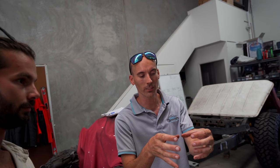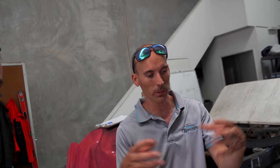You can cut the car in the middle, cut it wherever you want, and you can slide the back half away and slide it back in. Generally, we'll slide the back all the way out, clean it up, get all the paint off it, get it ready for rewelding, and just slide it back in. And wherever you stop, it's back in alignment. Then you can just make your extension, weld it off, and forget about it.